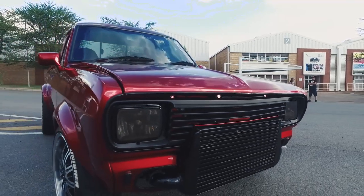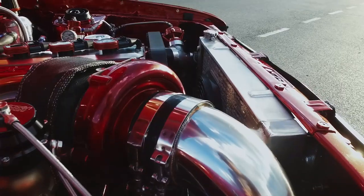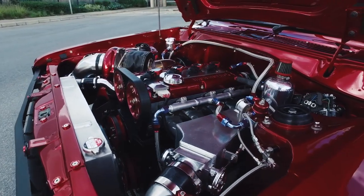The mods I did to the car were basically standard — just did the cams and the retainer kit on it, added a bigger turbo, and it makes 380kW on the back wheels.